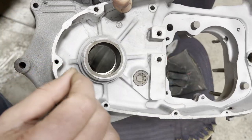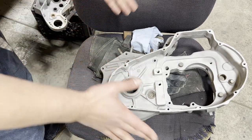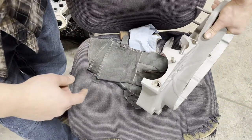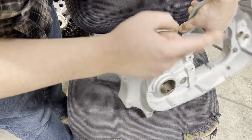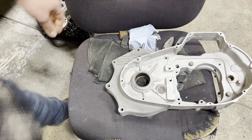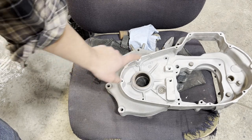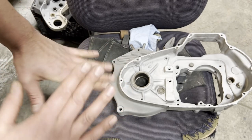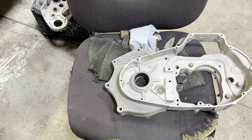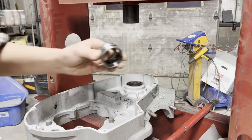In theory we could put the crank in, but I don't want to do that only because I unfortunately forgot — when I did a case prep video I never fixed the helicoil on the base stud here, and I have another one on the other side of the case for the oil pump. So I'll have to do a little bit of drilling and tapping, and I don't want the bearings in for this. But if the race is in I'm one step closer, and then it's just a matter of pressing the crank back in. We'll go over to the press, get set up, and drive this race in.